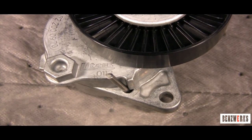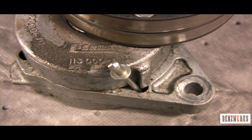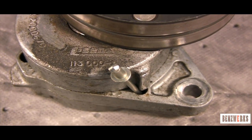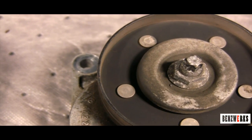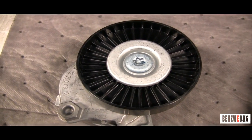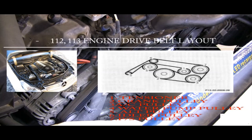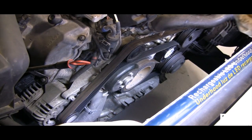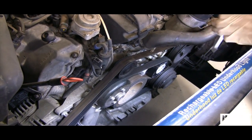I've already taken out the older style pulley and installed a newer style one. I'm showing you what it looks up close because you won't be able to see it from the position you'll be in when changing the belt. That adjuster — you do the same as the 17mm, just turn it towards the left with your 3/8 ratchet. The 273 and 272 motors all have the newer style. This is the 112/113 engine drive belt layout with all the different pulleys numbered; on the left is what it should look like on the engine cover, either V6 or V8.